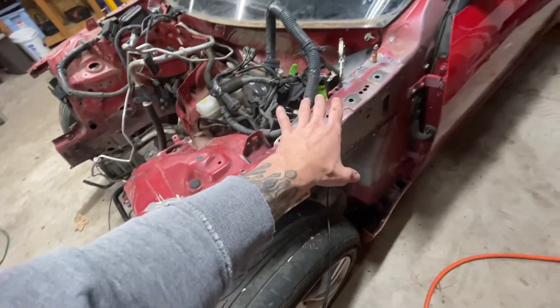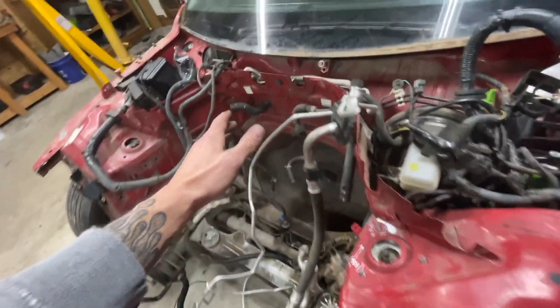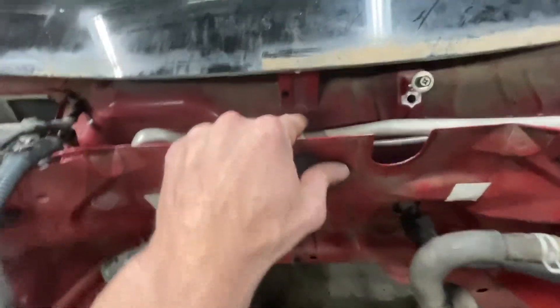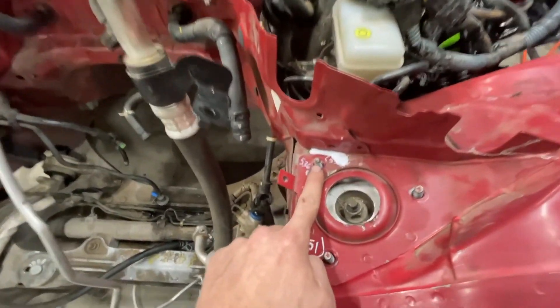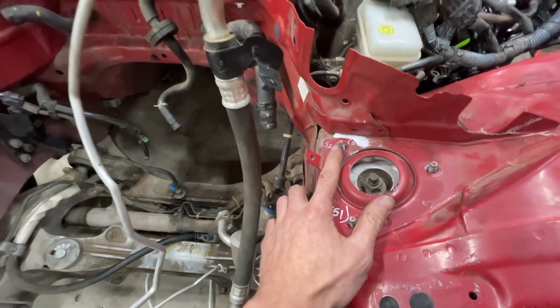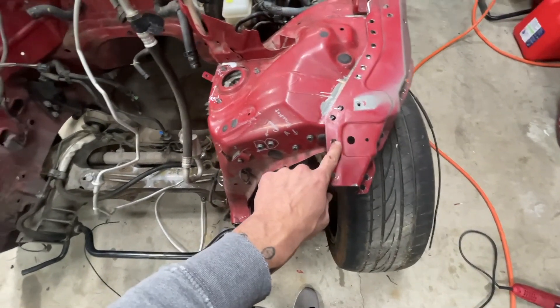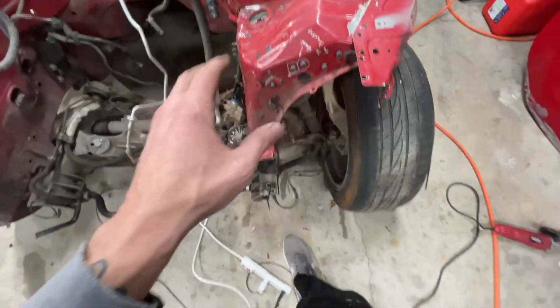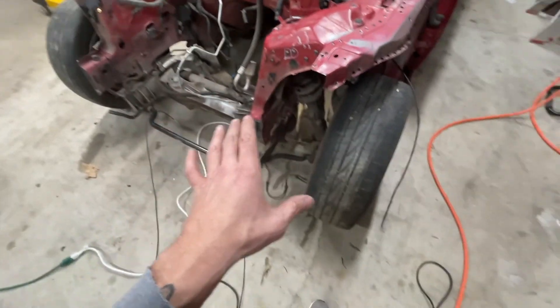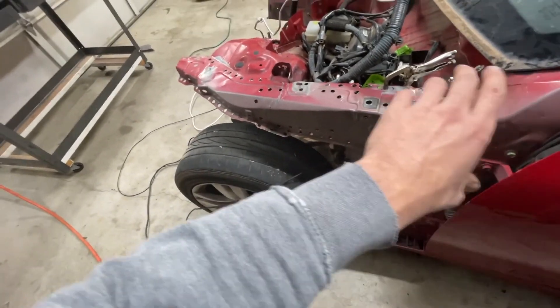I think it's called an apron — anyways, this piece right here I was measuring from. This is one of the main points you measure from, right here in the center underneath the head. So we measure from that point to here, and that's how I knew I got my strut tower back to the place it needs to be. There's also a measurement from this point to this hole, which tells me where this is supposed to sit, and I got that exactly where it needs to be. Then I measure from this hole to the other hole on the other side, and it's four millimeters off — I don't think that's going to throw off any body panels or anything. So this piece is ready to be sanded down clean, and then we'll put it on here and weld it back on.